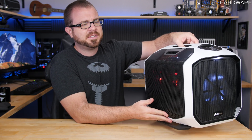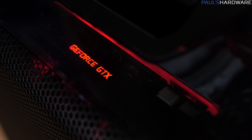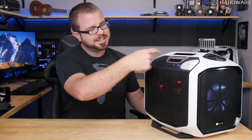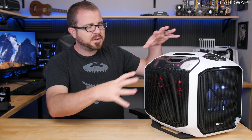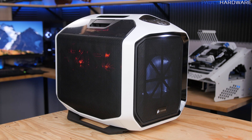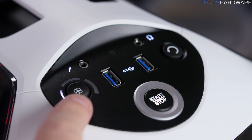So there it is, guys, and I must say I am very happy with how this build turned out. It is not light, but I can lift it up for transportation. I like the look of it overall — the LEDs on the Galax graphics card kind of peek through here, the edge-lit LEDs around the edge of it, as well as the LEDs in the fans. There's a white LED on the front intake fan as well, giving you the illusion of some hidden power within the smoky glass windows. It's really quiet with the fan controller set to the lowest speed. It's very nice to have a fan controller built in, since many ITX boards are really slim on fan headers. The fan controller allows you to do 3-speed fan control for either PWM or 3-pin voltage control fans.